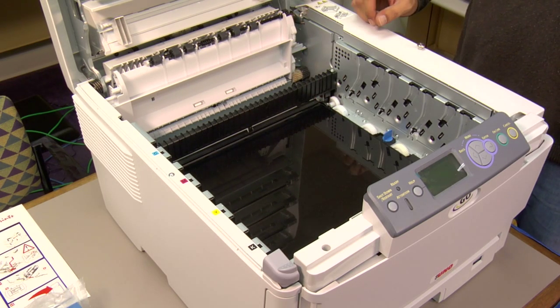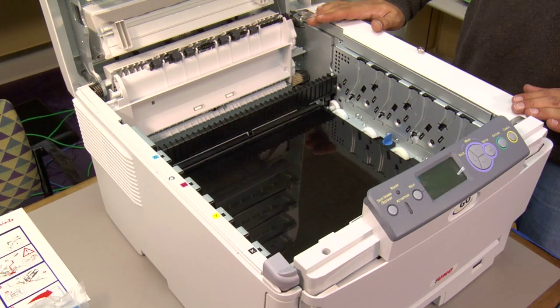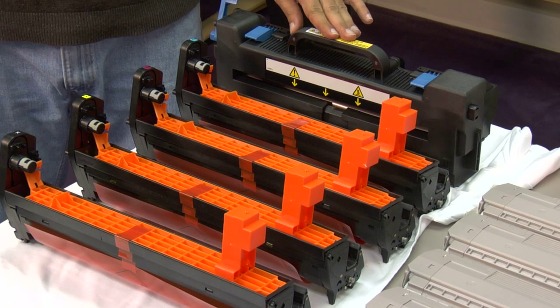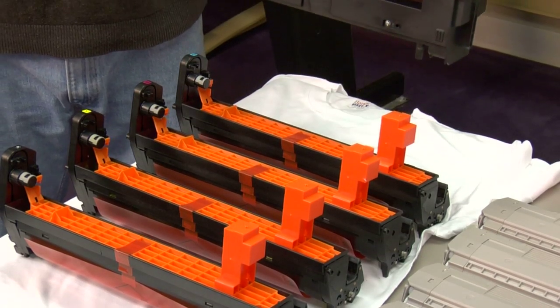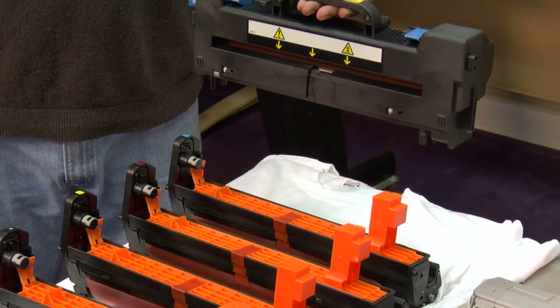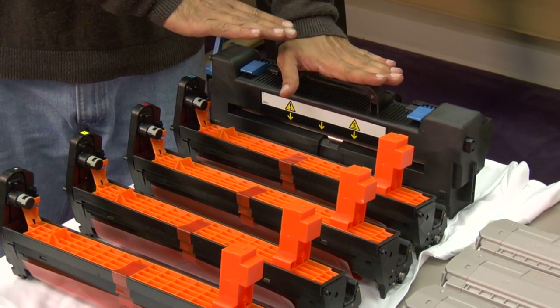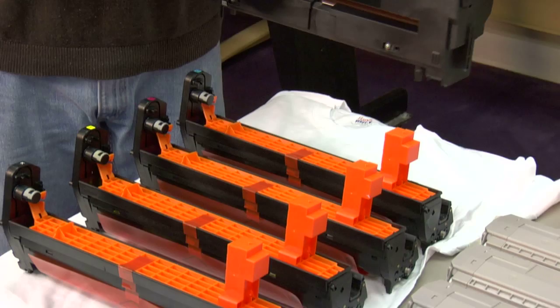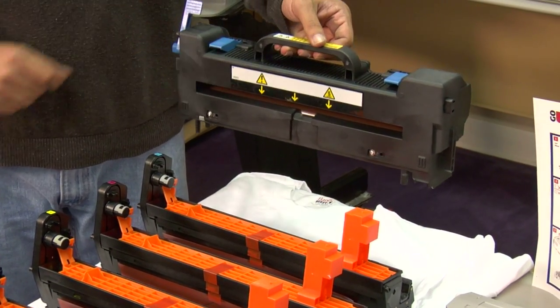When it comes to this black belt, you want to make sure that it's seated level. If you ever get an instance where a paper wants to go into the fuser section cockeyed and it jams right before the fuser, it means your belt might be slightly out of alignment and you need to check it. This fuser section unit heats up so when the transfer paper or page passes through, the heat generated bonds the toner to the page.